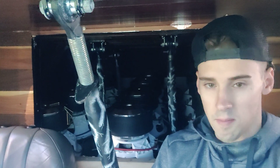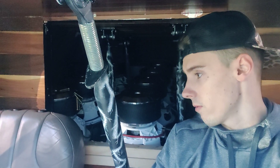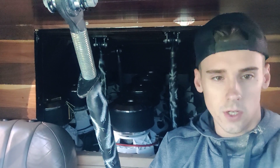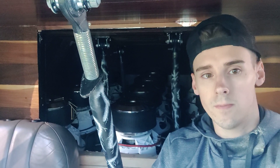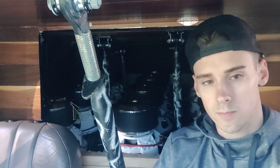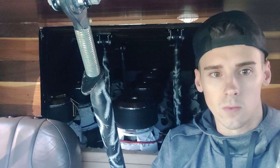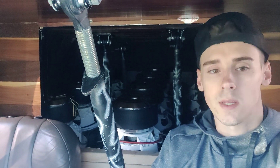Now on to the Platinums. The Platinums' FS is about 29-30 hertz, which means they basically excel at lower frequencies. They do have a little bit more power handling — 2,000 watt RMS. Of course they can take more than 1,500 watts, but a lot of times that's for burps. I'm not saying you can't play 3,000-ish watts, but when I would start giving my previous sub rated power, they would start to get stinky after a song or two and you'd have to turn it down.